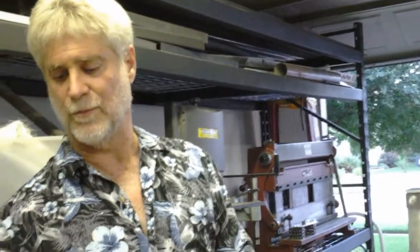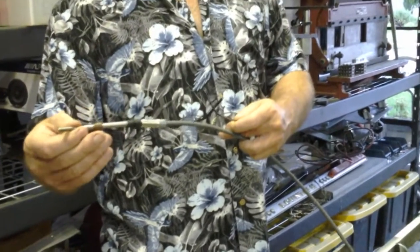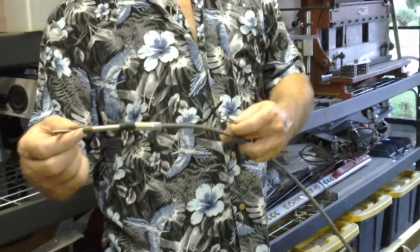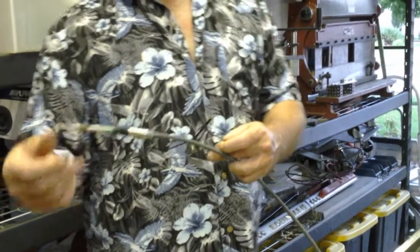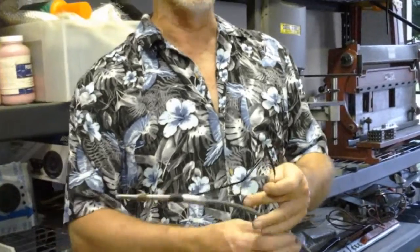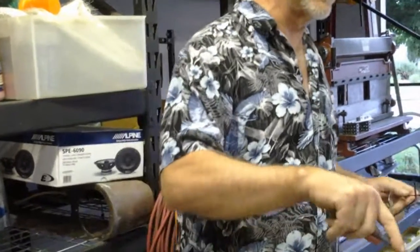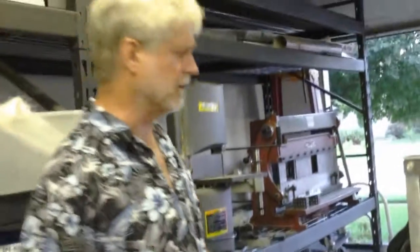Cablecraft has stores everywhere in the world. I like Control Cables Incorporated out of California, but this is a simple Morse cable. It's a push-pull cable as opposed to a throttle cable or something, which is a pull-only cable. This is the ultra light. They have ultra light, light, medium, heavy, and so forth versions of this, but the ultra light version is actually a 40 pound rating. So unless we are hanging a sack of concrete from our shifter, we're way good on that.